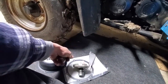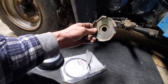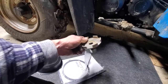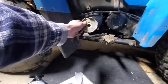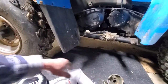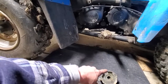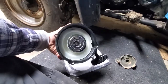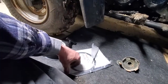The one that's on there does not have these catches for the pull start to engage. There's also a small o-ring in there, but this new piece will bolt right into the center of that, and they even included the original bolt. So I'm gonna get this cover off, pull off the original one, install this one, put the gasket on, and then put the pull start on.